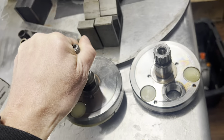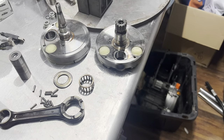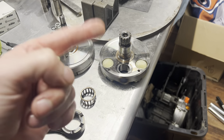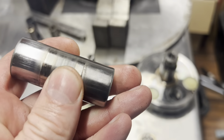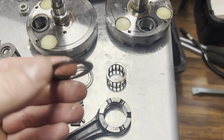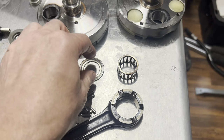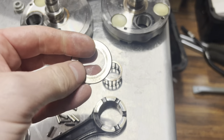What's happening there is at high RPM these crank webs want to flex on that pin, and the higher RPM you go the worse that becomes. It's because the crank weights are not dead center — they're offset because the rod is in the middle — so they want to flex and you see that little flex mark that occurs over time. The thrust washers are actually in pretty good shape. You can see where they're wearing but there's no feelable wear, so that's good. Everything looks good in the crankshaft department.